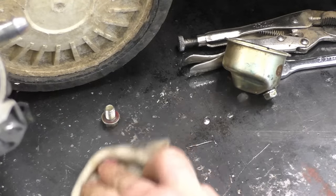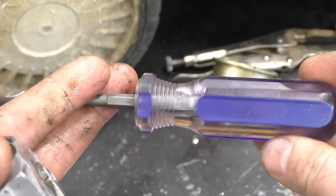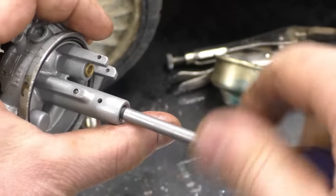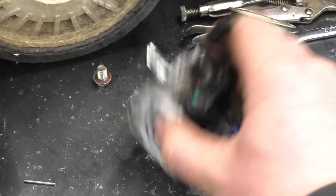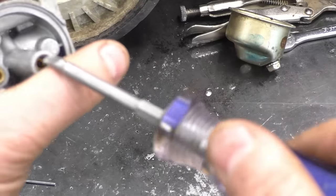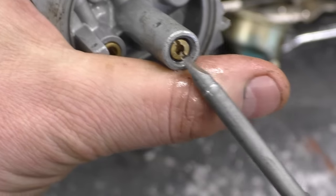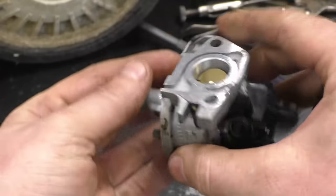Keep your area very clean when you're working on a carburetor. What I use are these gunsmithing screwdrivers — they go in nice and straight and flat. I will actually unscrew that metal jet. Once you think you've unscrewed it all the way, you do have to tap the carb sometimes just to get it to come right off. It's almost out but it just doesn't quite want to come out here.